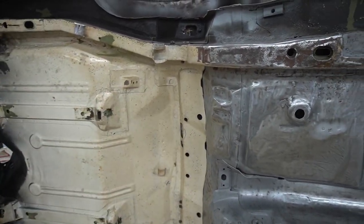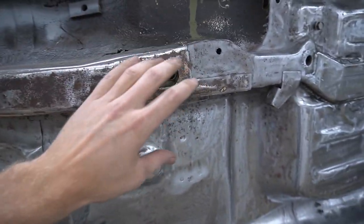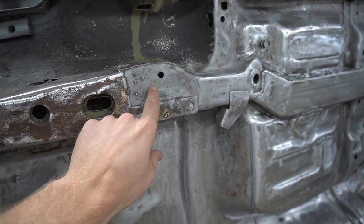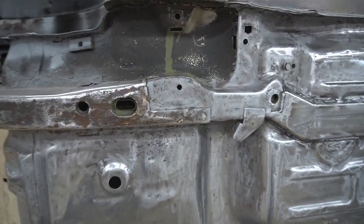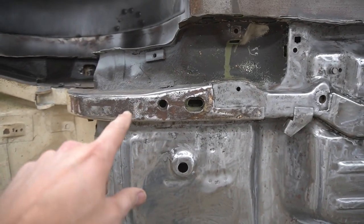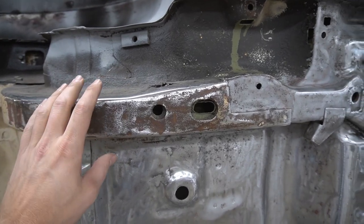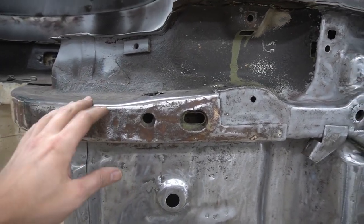I can find the rear section, I can find the whole rail, but just the front sections at a reasonable price — not having luck right now. So this is on hold and that's why I kind of stopped here. I'm not going to be replacing those frame rails or anything, but definitely somewhere in here. And I'm not going to do any of this until I figure out what I'm doing. So if I get this frame rail off and cut the top of this torque box off, then if I see everything's rotted in there, we'll talk about replacing the whole thing. But if not, I'm just going to repair this area to where it needs and go from there.